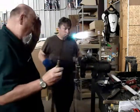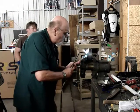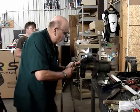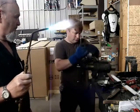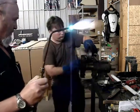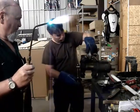Two down, four to go. Just a few seconds. I'm doing a circular pattern right on the outside edges of that Allen bolt. Jesse gets them right out. Just loosen them. Once they're loosened, we'll be able to take them the rest of the way out. He rotates the flywheel and the vise 180 degrees so I can get the top three.